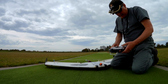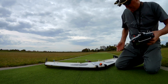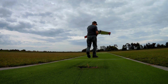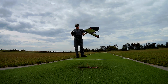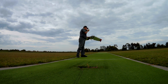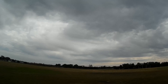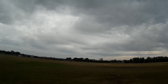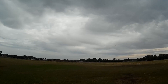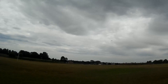We just have to wait until the satellites are acquired. I'll do line of sight first and just test out that everything's working. I do have launch assist, but I'm going to launch it normally first because I find it easier to launch like that — you've got the prop assisting your arm in the throw. If you use the iNav launch assist, you've got to do all the throw yourself.